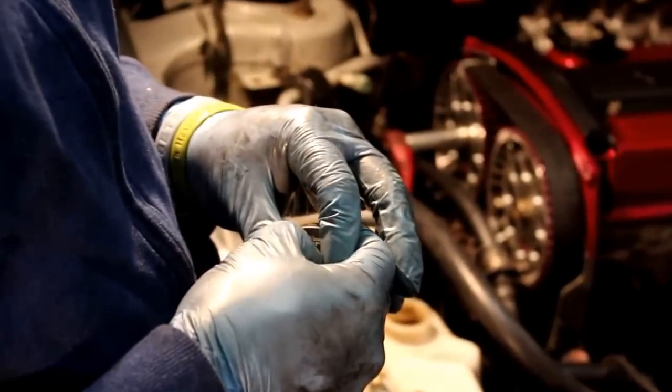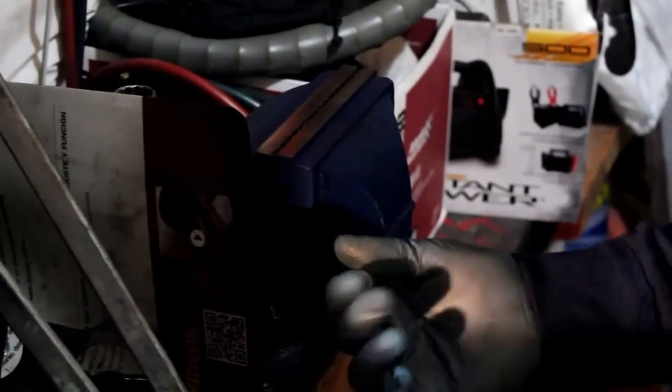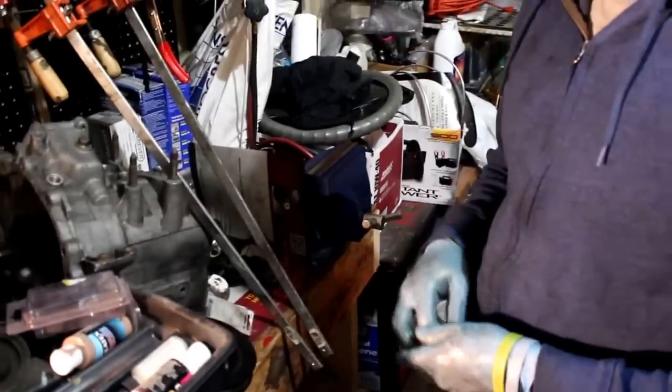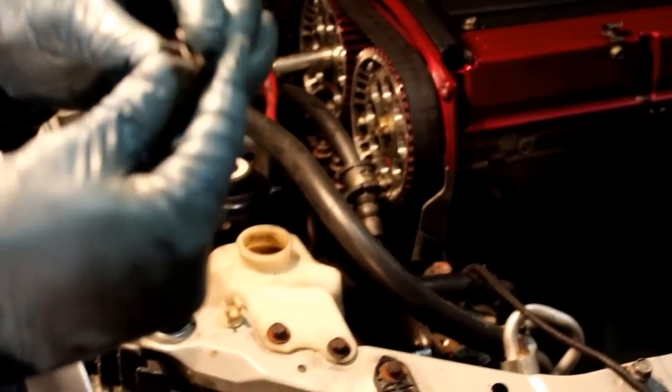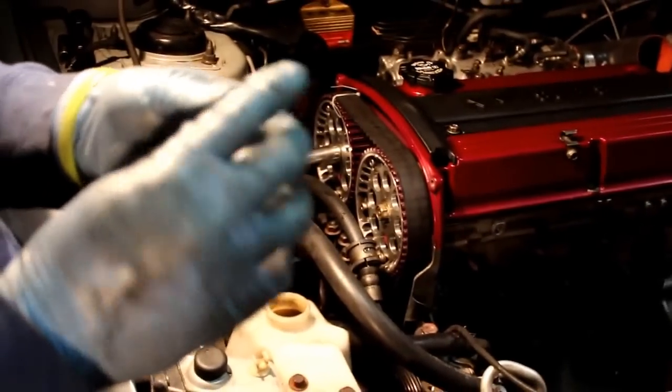If you notice on the actual timing belt tensioner, you have to compress it again really slowly. You put it on the vise, and you pretty much do a half turn on the vise, compressing the tensioner about every 30 seconds. But now the tensioner itself is automatic. There's a bracket, and in order to actually move the pulley, there's two dots. You get yourself something like this.